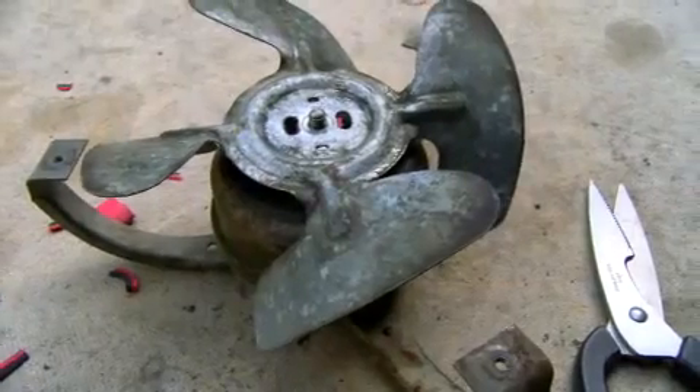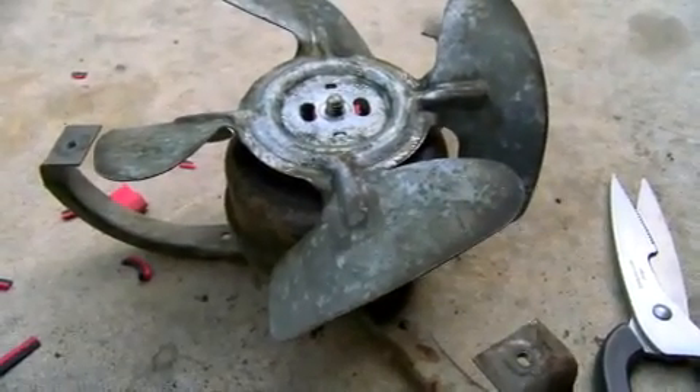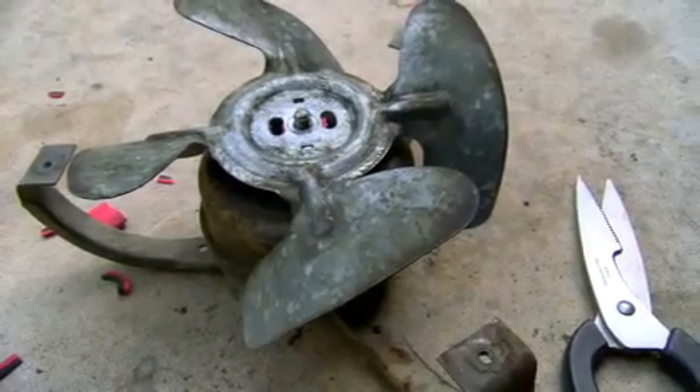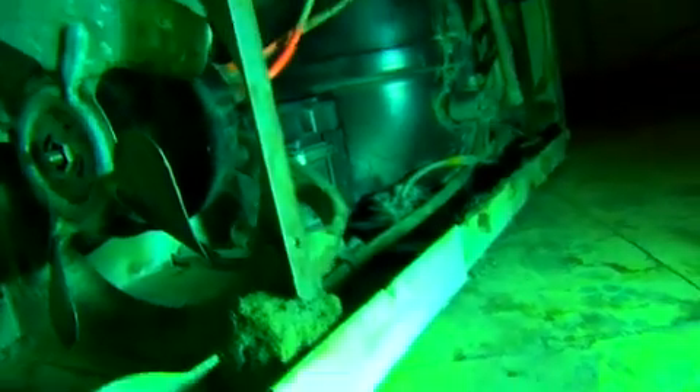When they get dirty, of course, it can't get rid of the heat, so it just runs and runs and runs up the electric bill. Forced air condensers under a domestic refrigerator in the kitchen was never a good idea in my opinion. It's tough to get in here, but this is the fan — it's been oiled and it's all back in. That's the condenser coil down there, and I just cleaned it with an air compressor and vacuum. It's also really important to have this cardboard back on because that's what directs the air. If you just take that and throw it away because it's dirty and rotten, then the thing is not going to work well at all.